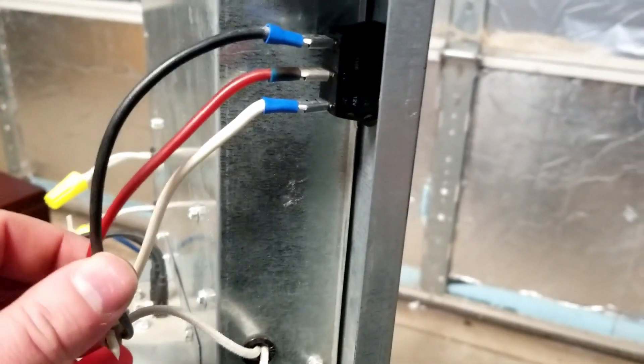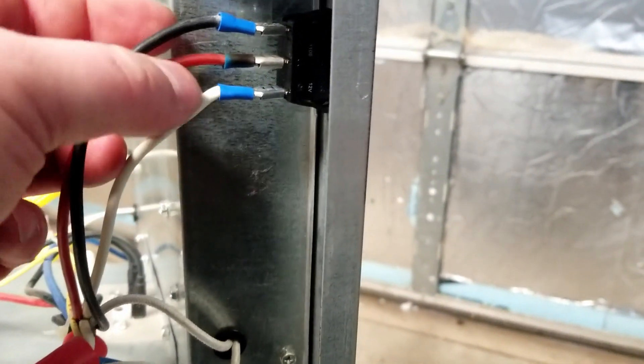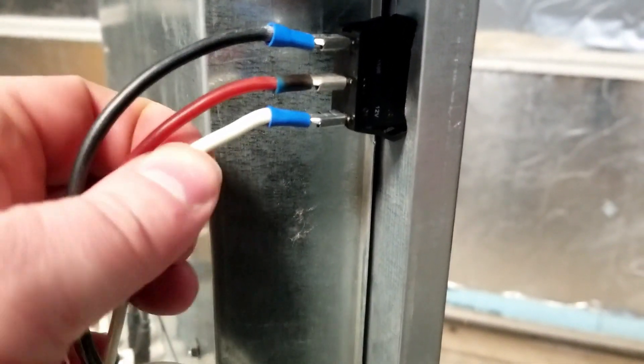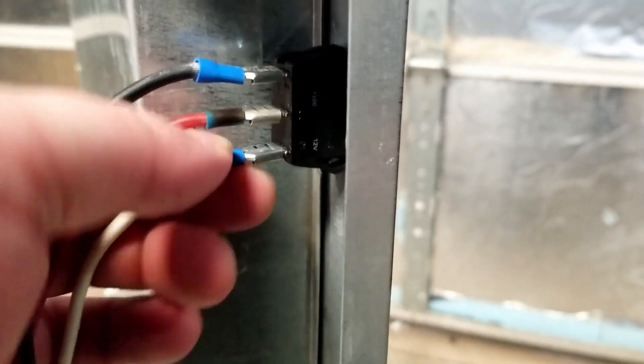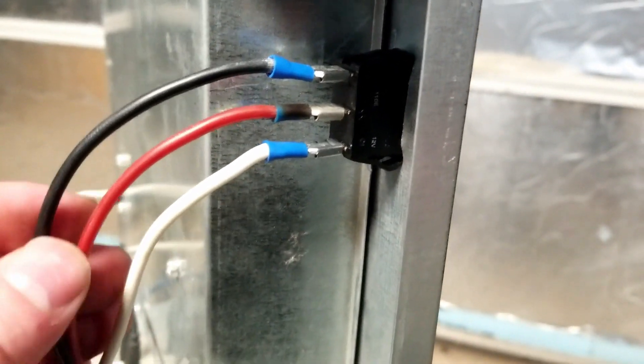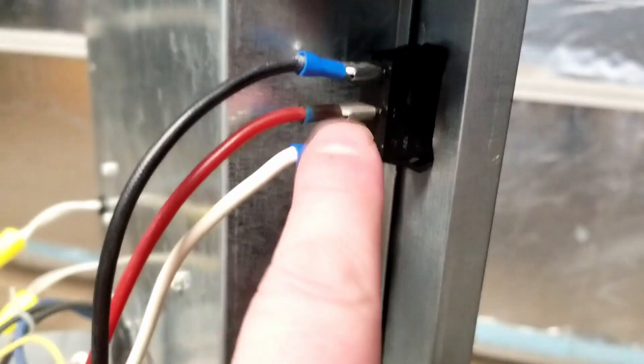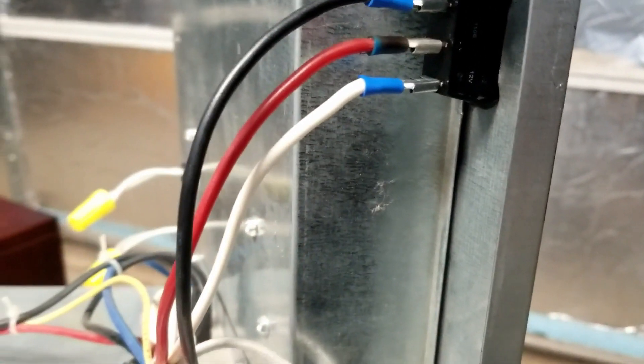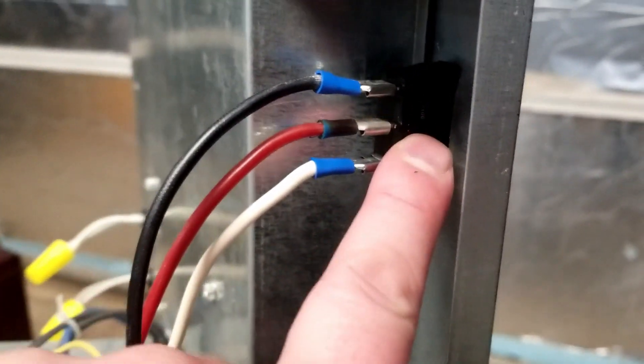You've got to watch out for high resistance — when you feel your cords, outlets, and things starting to get warm and hot, that's the first red flag. You've got to look at something, because if you let it go unchecked, you might burn your house down. And that's never a good thing. That's why we started looking at this heater — the switch was broken and the cord was getting hot. That means there's a problem.